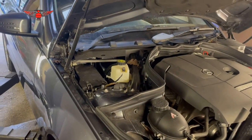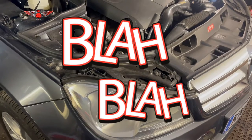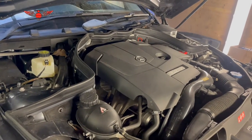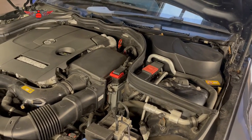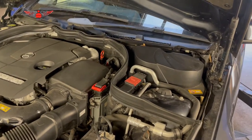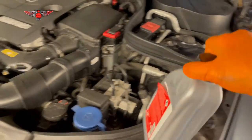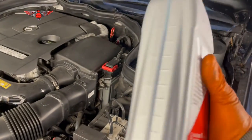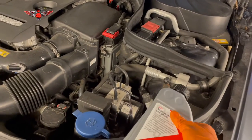Welcome to the video. Today I have this Mercedes C-Class — it's a W204 031 chassis, a 2013 C180. I'm going to be changing the transmission fluid. This W204 is slightly different to the earlier W204 models: it doesn't use the red ATF oil we normally use. It uses a blue type of fluid, not the red type — just something to bear in mind.